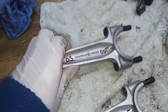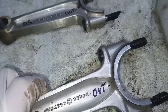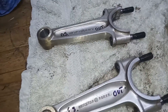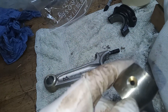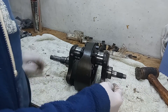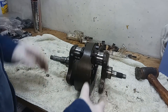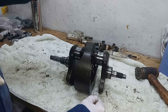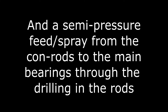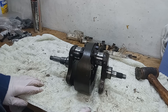The drilling comes out here to sort of splash-spray-feed the main bearings - as the conrod goes round there's a point where it can spray straight onto the main bearings when the flange isn't in the way. That's why the conrods are fitted different ways round - they both need to face with the oil hole outwards to give extra lubrication to the main bearings, which are not force-lubricated under pressure. There's also a hole in the top of the conrod feeding the small ends, and a separate oil pipe to the cylinder head for the rockers - but apart from that everything is splash-fed.